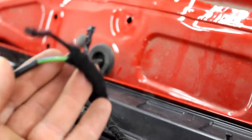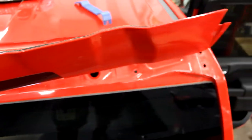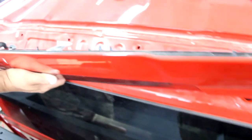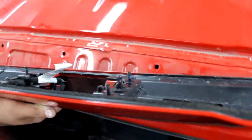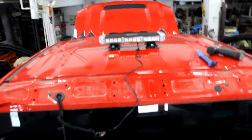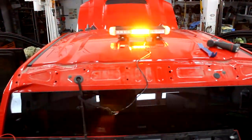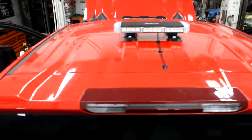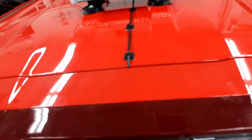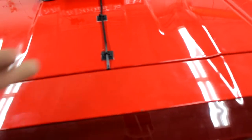I'm impressed that GM did this from the factory. I am a Chevy guy and this here is a nightmare — I don't understand why they couldn't have put pull-out tabs to take this off from the outside. An awful lot of work; it's not terrible, but it's not quick. That's my only complaint so far. Alright, aux 5 test — we've got our power and ground, heat shrink connectors done up. Hit aux 5 — look at that! Our light's on. Used some 3M adhesive square connectors with zip ties. Not the greatest fit, but it's good for a cheap light.